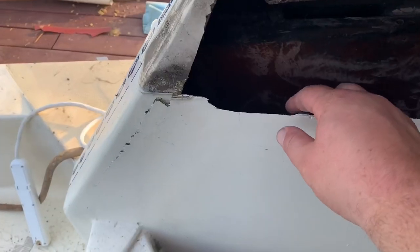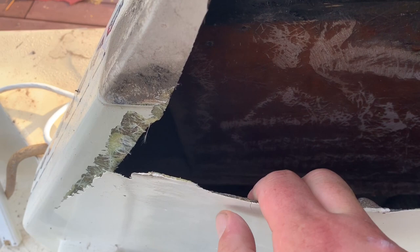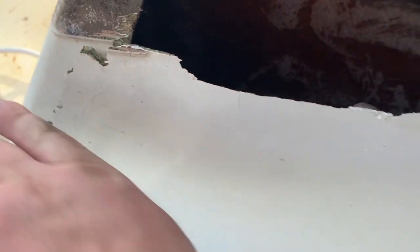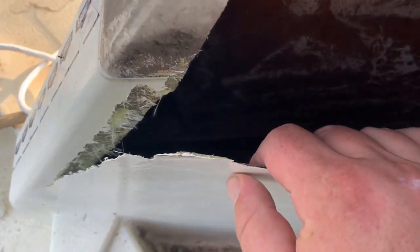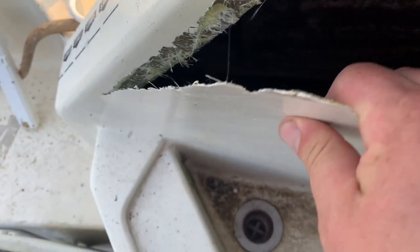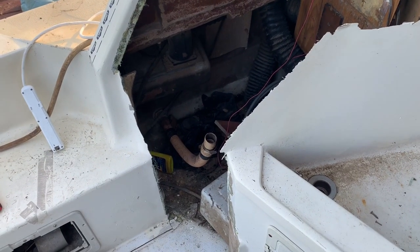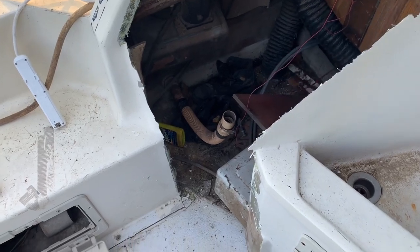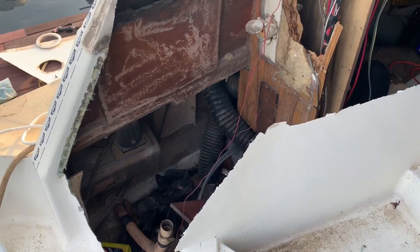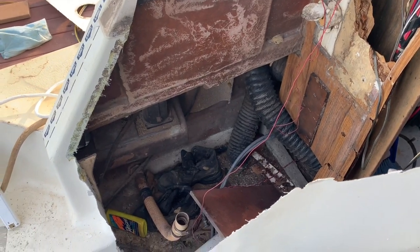See this repair that they made — the real glass is cut away back there, and then this stuff is just run to the face of it here instead of wrapping it around to make a strong repair. So it's really not hard to take out of here. I just gave it a swift jerk and the whole thing came out. Poor repair work, bad form. We're gonna get back down to the actual fiberglass boat here and put it back together in our own image.